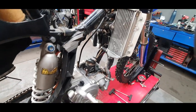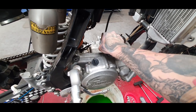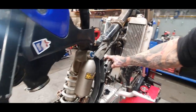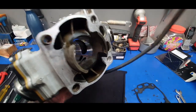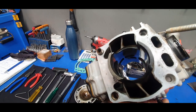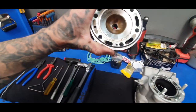I just got the head and the barrel off the motor and this is what we're left with. So we've got a piston, rings in there, head gasket. It all looks pretty damn good in there realistically — it's getting new piston rings put in it. You've got the barrel and the head sitting down there. I haven't really had a look inside the barrel as of yet, but it looks pretty nice up in there. It's hard to say there's something wrong in there when it's looking like that.